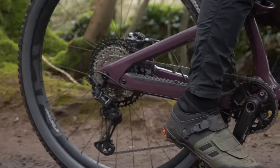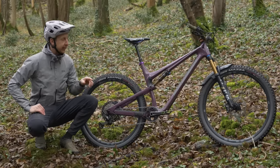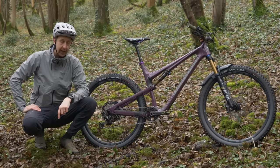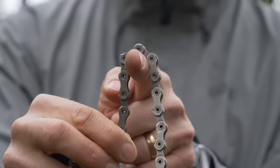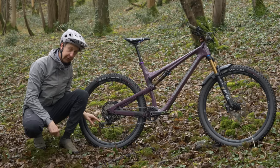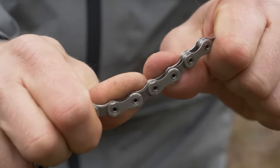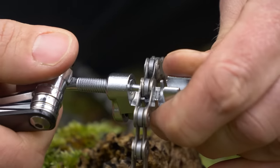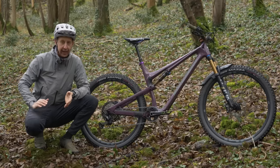Go systematically through those gears and experiment with the barrel adjuster on the shifter. If it's still not playing ball, then really there are a couple of other things it could be. Your inner cable inside the outer housing could be completely filthy — if there's friction in there, that's going to affect everything, in which case it's time for a new inner cable. Whilst you're at it, flush out that outer housing with some good lubricant. There's one other thing that can happen which we haven't referenced: you might have a stiff link on your chain. If you're noticing any clicking whilst you're pedaling, cycle your pedals backwards and watch what the pulley wheels are doing. If there's a stiff link, you'll see it will just jump up and down very slightly as it goes past. To get rid of that, you can literally manipulate that chain link by hand, or with a good multi-tool that has two sets of jaws on the chain guide. Put your chain in the closest jaw to you — basically you can use this to just free that link up very slightly. All it does is just enable the outer links to free up any pressure that causes the stiff link.